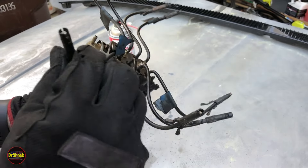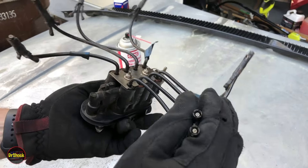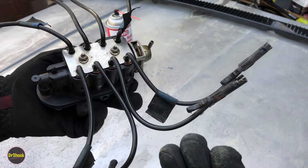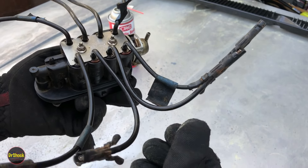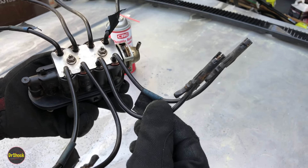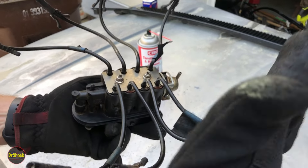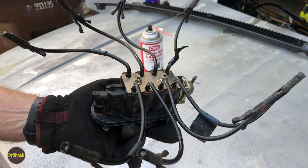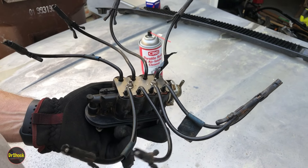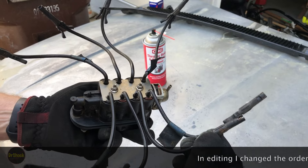We're also missing almost the entire shroud of the end on the number seven cylinder. This is the original 1998 CSFI setup. I'm going to show you how to rebuild this — I'm not a fan of the MFI conversion for these OBS trucks, so I'll show you how to rebuild the CSFI. I find the CSFI is perfectly fine. This setup has close to 400,000 miles on it, trouble-free with no misfires. There are a set of things you have to do to get that kind of performance out of this.